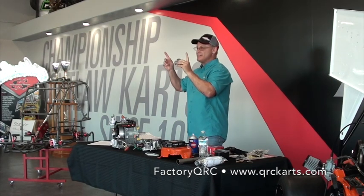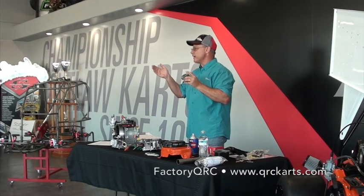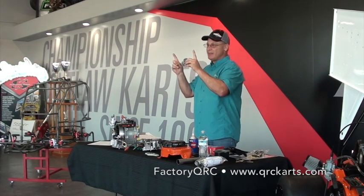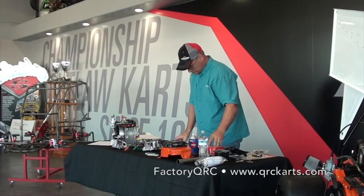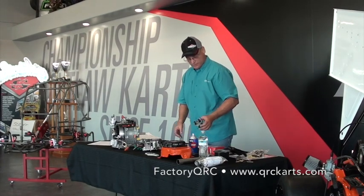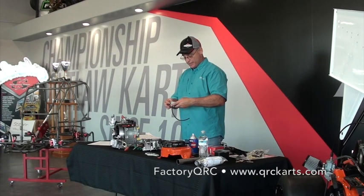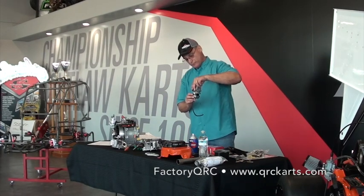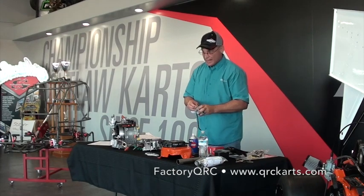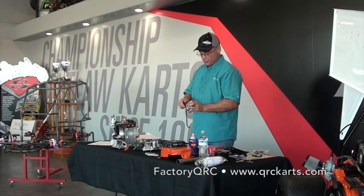Going back to the 890, 880, 860, 840 — some people say if I spend all my time on the bottom end of a racetrack, I still want it to be in the sweet spot of fuel. If I see color in the spark plug, I'm throwing too much fuel at it. What I'm going to do next is the intake manifold, and this is huge, guys. Because we're talking about that series of quarter percent — so far we've figured we've picked up maybe about three-quarters of a percent by making the adjustments that we have.